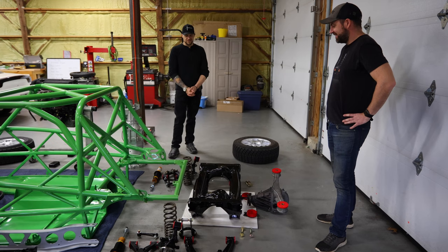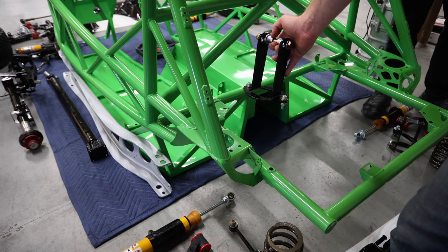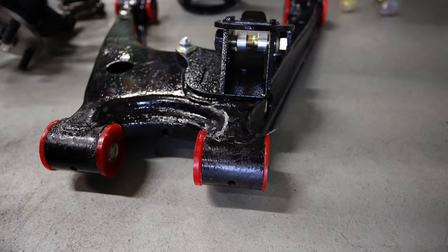Anyways, so here's the rear Paco setup. They give you an extended, I guess what would you call that? That's really the upper head. Upper, it's a shock mount. Shock mount, which actually bolts above the frame, which we showed. Did we show? No, I don't think we showed. Yeah, well, we're showing it again. It's a really cool kit. They give you a new upper A-arm for the rear. Yep, and use a factory lower, and then we have the adapters for the lower shock too, which are already installed. Yeah, and it actually inverts the shock in the back. Mm-hmm. The mounts are inverted.